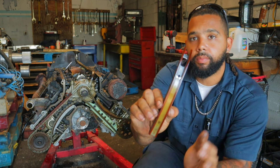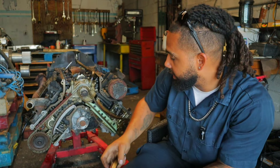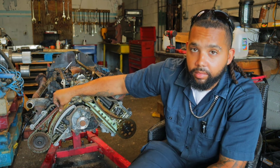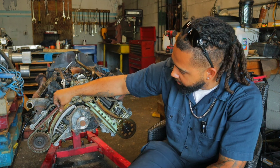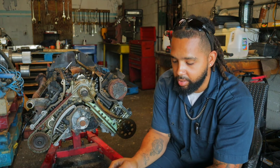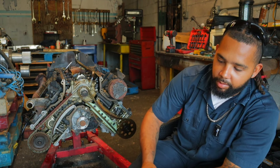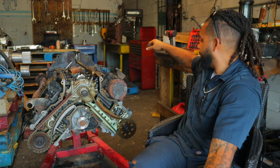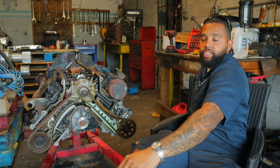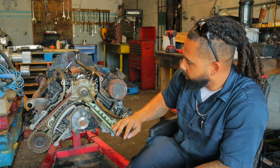I changed another tensioner that I thought was pretty bad, but these two on the outside are very good so I'm not going to bother with those. We also had an issue with the oil pickup tube — it was bent and I brought it back up to where it was supposed to be. The dipstick tube as well had an issue where it was bent. From the accident it just got cracked, so we ended up changing that as well. But the detrimental part of the motor was actually this tensioner and this timing chain — that would have caused a catastrophic failure.